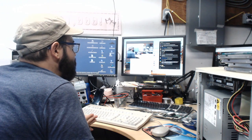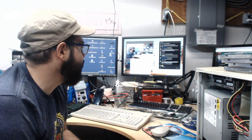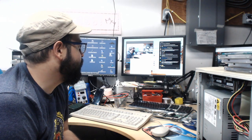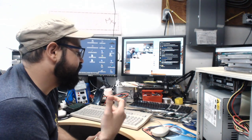Video output on my Quadra 700 is very fuzzy. It's something unusual for that model, with electrical noise or some sort. PSU has not been recapped. I don't have a 700 myself, but if you are dealing with fuzzy video, it might be the adapter you're using or some noise. Are you using a Macintosh CRT or using a VGA adapter?